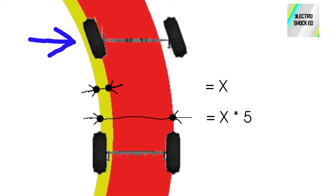Because these wheels will be mounted at the front and at the rear of a two-wheel vehicle. While making the same turn, the difference in speeds will be minimal compared to wheels mounted on the same axle like on a four-wheel vehicle. So there won't be as much difference in rotation speeds between wheels when turning. Also, when you make a turn, you are often braking at the same time, so you're not applying power there anyway.